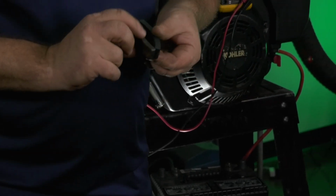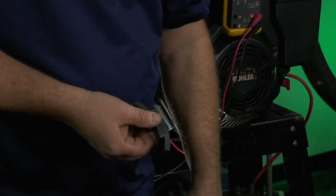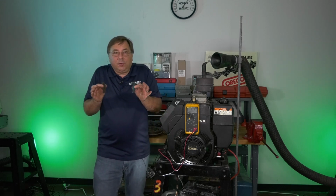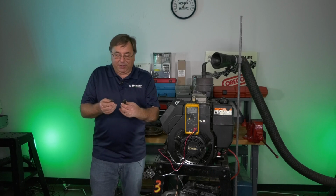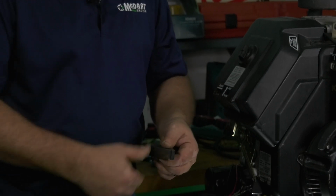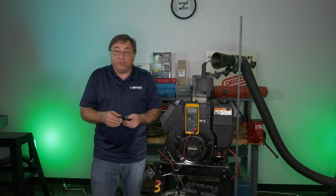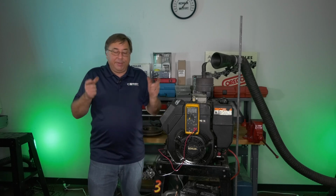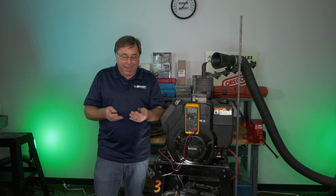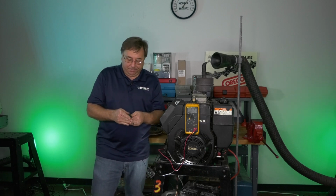The next two snap together. I can't put them in the center, and I can't put them back to back unless they offset. So that's something that was talked about many years ago that they can do with magnets. And everybody just went, wait a minute, he's doing some kind of magic trick because there's no way you should be able to rotate it. So again, the reality is it's a legality issue. Don't glue them in. You're taking on the liability. They are put in by robots at Kohler. They're glued in place. Machine comes down and it magnetizes the material after the flywheel is assembled.